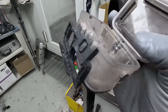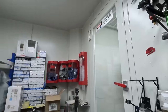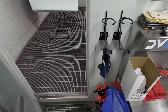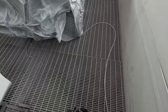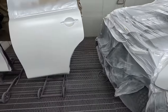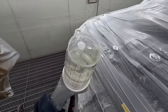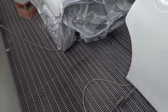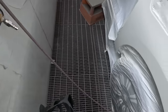I just did a recent video on two bonnets on this channel and that was pretty popular, so I thought I'd do another one in a similar vein — kind of live. It's a little bit easier than going home, putting it into the editor, and doing the voiceover. So this is the job: a Nissan Patrol full respray. I've already done the roof — I like to do the roof separately. I've tried doing them at the same time but you just end up trying to lean over a quarter panel while you're up on your stands, which is not ideal.